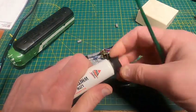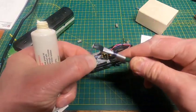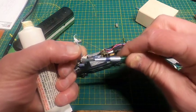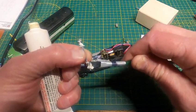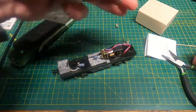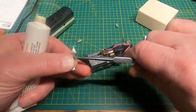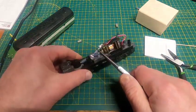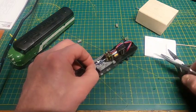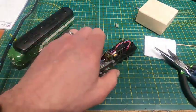So we get our white grease and put a little bit on there. You really shouldn't need grease in there, but these are plastic parts and they rattle, and it keeps them a little bit quieter. You don't need it necessarily for lubrication as much as to keep it quiet. Now, where did that screw go?